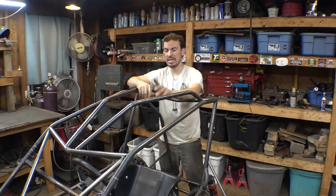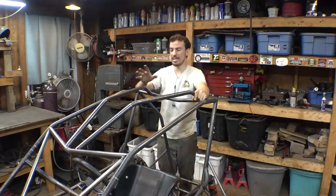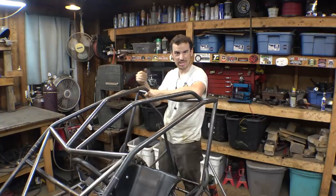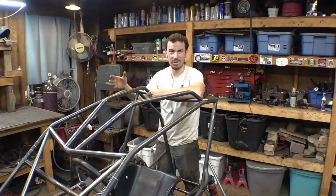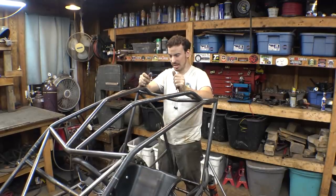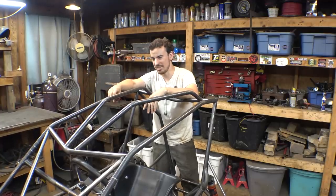We can either have my left foot being either clutch or gear shifter. But if it's a gear shifter, where am I going to put the clutch? It kind of makes sense. This is the way that I'm probably going to do it. It makes sense to have the left foot being brakes, right foot being throttle, and then a normal gear shifter that I do on most of my vehicles, and then have the clutch be a hand lever, basically just like on the motorcycle engine. So clutch, gear shifter, brakes, throttle, steering, and then in between my legs is going to be the transfer case gear shifter. So I think that's how we're going to have to do the controls in this thing. There isn't really that many other options for that.